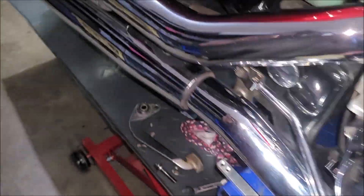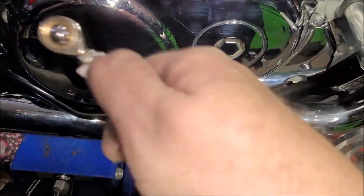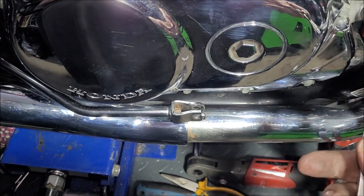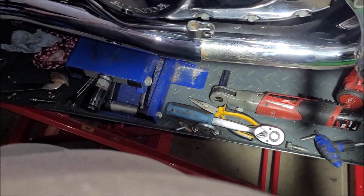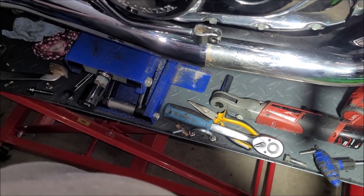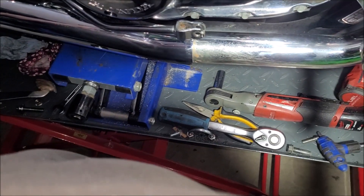Was not as easy as it looked. So I made up a stop — it needs some refinement but it gives you the gist. I cut 5mm off this, drilled a little bit further, re-tapped it — so that's as far as it can go. And this end I've re-drilled and tapped where it mounts in here. That is the only way I'm going to get enough preload for it to actually operate the brake. Not ideal — the whole kit's a little dodgy if you ask me, but it's here, I got it, it'll look alright when I'm done.